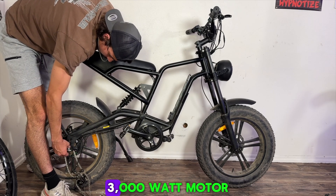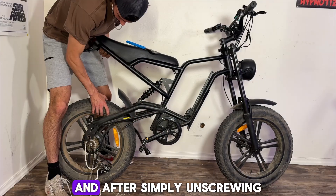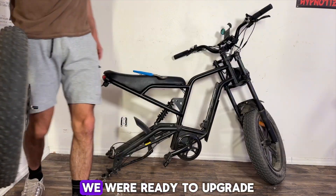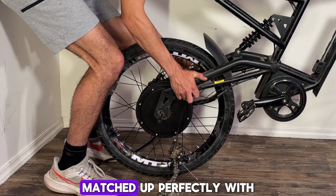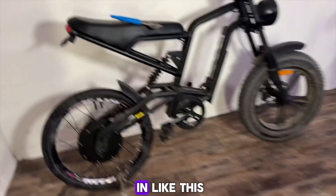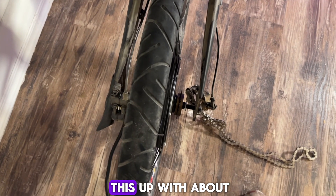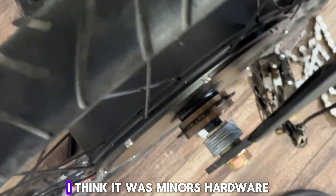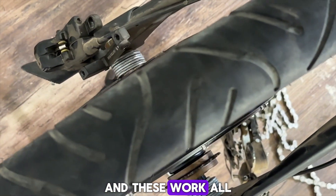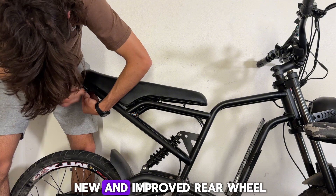The very first step of this build process was replacing our rear wheel with our 72 volt 3,000 watt motor. I did this by first unplugging our stock rear motor, then taking off the rear wheel, and after simply unscrewing the nuts which held in our original motor, we were ready to upgrade. This was actually super easy because the diameter of the slots for the rear axle matched up perfectly with the motor I already had, so it just slid right in. The only issue was a lot of space left between the axle and the motor, so we had to fill it with about an inch of spacers from the hardware store.